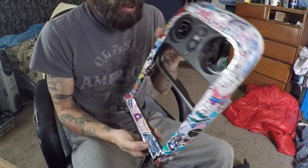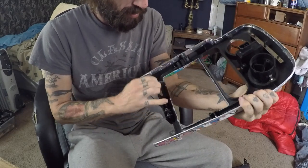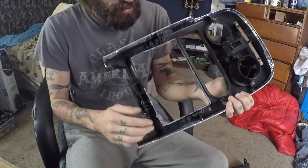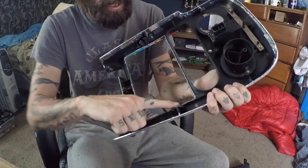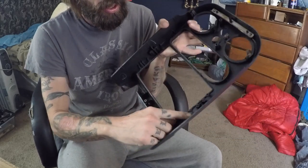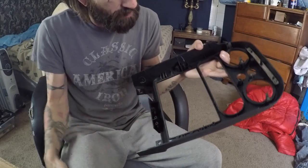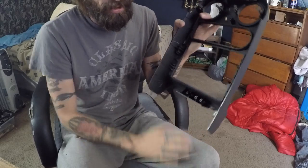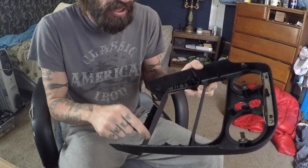I have my original that I did a while back — the o-ring's kind of coming off. I can make a new one, but I'm using this as a template to see where I need to cut back and grind out with the Dremel. I've started the grinding, getting all the little fins out of the way for the charging port and headphone jack, and also leveling this edge. I pretty much ran it till the battery was almost dead so I'm charging it back up.